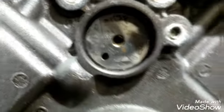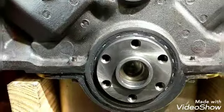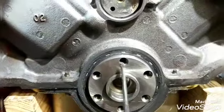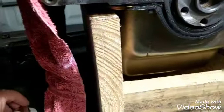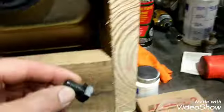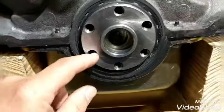So I've just got left to put that plug in, put the insulator plate on, and then put the flex plate on. One thing on the flex plate - newer model crankshafts are not drilled all the way through, some are like the older cranks and I think the 350 ones are. So you've got to use sealant on the bolts, along with your ARP lube. I put lube underneath the bolt head itself, because my buddy Tim found out a while back that some go all the way through and start leaking out of the bolts when you fire it up.